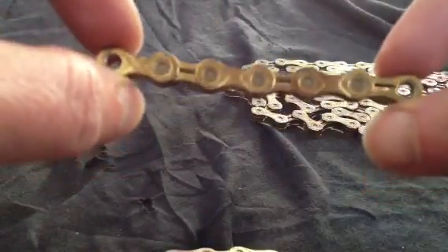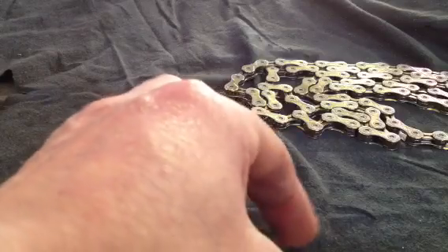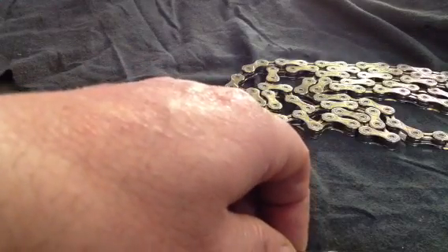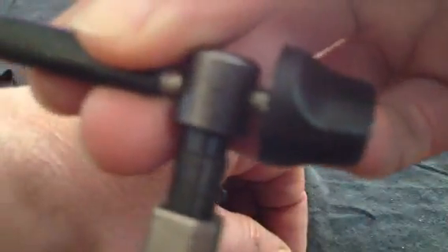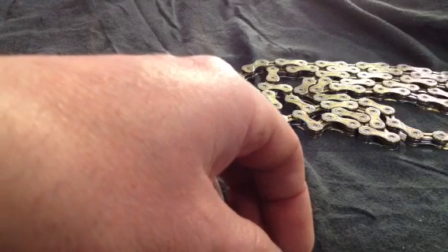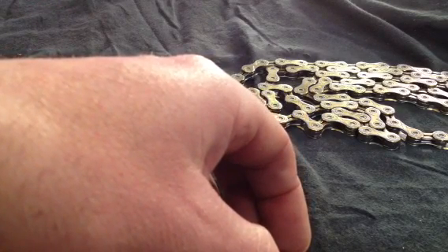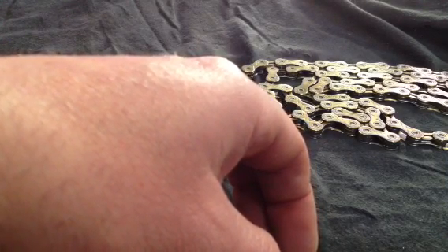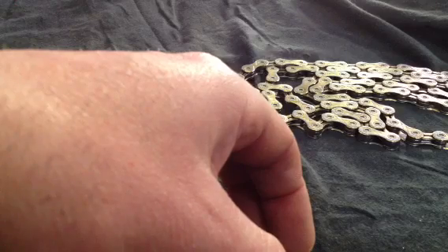What I'm going to do is use as a guide the piece I took off my other chain. I've got a little Park Tool here — it's not top quality, but it's plenty good enough — and I've put a skewer on the end for some extra leverage. With the setup I've got — a 53/39 with an Ultegra short cage rear mech and a 12-25 cassette — I need to take a few links out so everything is tight and works fine. You don't want a sloppy chain when you're on the big ring up front.